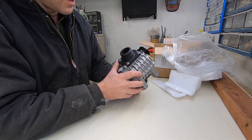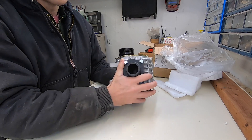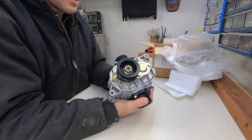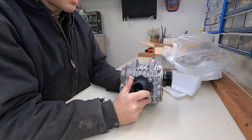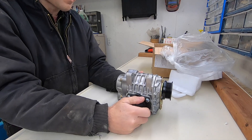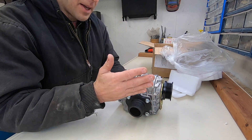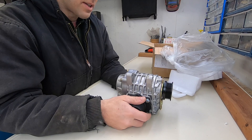The AMR 300 displaces 300 cc's of air volume per revolution — this is a Roots supercharger. I am going to be making my own manifold, and I'm hoping to make it so that this basically bolts directly onto the intake of the engine. I'm also considering, depending on funding, attaching this to a water-cooled intercooler that then attaches directly to the engine.